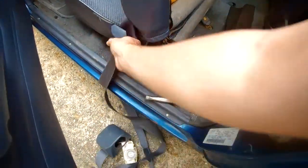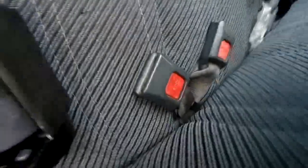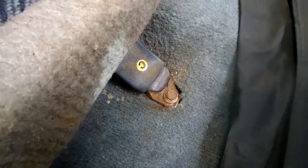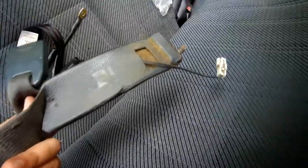There you have your old seat belt assembly, which in my case and probably yours is junk. Now all that's left is to pick out the buckle right here. The way that attaches - when you move the seat forward and tilt it forward, right over there you have that last bolt and you can take the buckle out. With that bolt out this should just pull right up. There you have your little connector for the seat belt - make sure it's plugged in. After it's unbolted and the seat belt plug is disconnected, just pull it right up. And that's all there is to removing it.